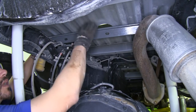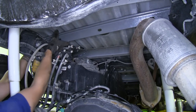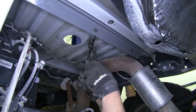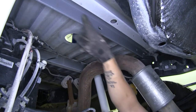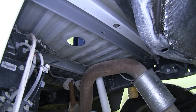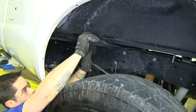This bar goes all the way back as far as possible against the other crossbeam on the bed — possibly using a pry bar or pliers to get it where needed. Once the bar is all the way back to the crossbar, take a pair of channel locks, grab it, and rotate it so the holes are up and down with the top section butted up against the crossbar on our bed. Then take the other bar with two notches and do the same thing, sliding it in from the driver's side going toward the passenger side.